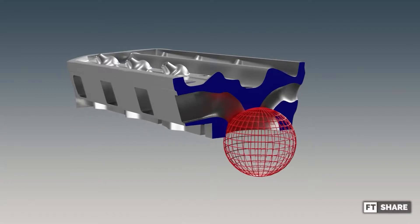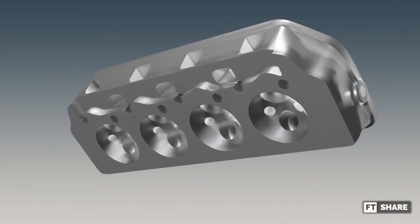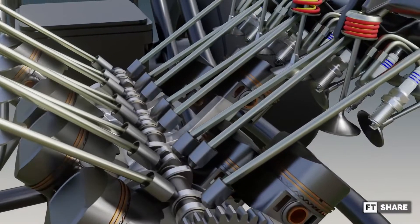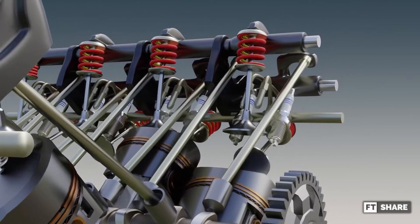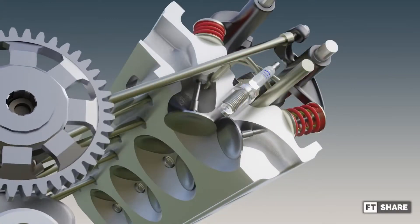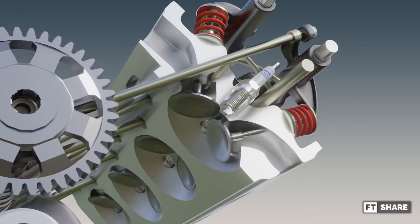However, its application in the top fuel dragster is reduced, to pursue a high compression ratio. From its half-spherical shape, the top fuel dragster uses only two valves. If we use four valves per cylinder, apart from the torque going down, the engine's weight will also increase. More springs means more power needed every power cycle, which will reduce torque at low RPM and acceleration of the vehicle.